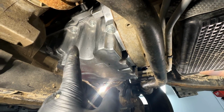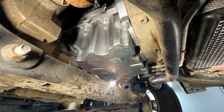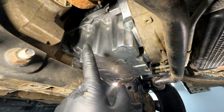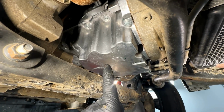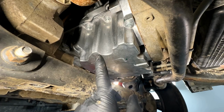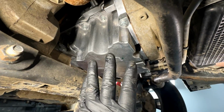I said, wait a second, why is that? How could it not mate up to the bell housing? They're all 10R80s, etc., etc. So I'm happy to report that the original pan that comes on here, it's sealed up perfectly. You know, the all aluminum one-piecers that don't leak, does work, so you don't need to take it off of there. And of course, since they built it at the factory, that engine, to match this pan, it already has the proper pickup on it inside of there. So we just left it alone, didn't touch anything.